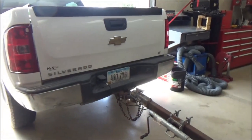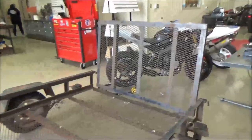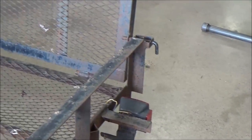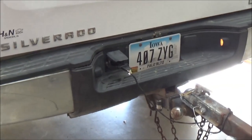As you can see, my truck lights are all working fine. On the trailer itself, I have one light working — I'm not even sure yet if it's a brake or a taillight — and on the other side it's not working at all. Sometimes this can be hard when you're working alone, having to prop something on the brake pedal to test it, but you've got to be creative. So I've got nothing on one side, which makes me think the truck itself might not be the issue.